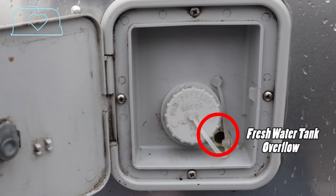The next failure was our check valve in the fresh water system. This is something I see a whole lot of posts about in RV forums on Facebook and elsewhere. You can tell your check valve has failed when you hook up the city water and slowly, slowly your fresh tank fills up until it starts dumping water out of the overflow — which is never a good thing.